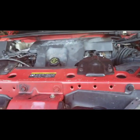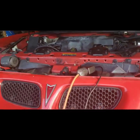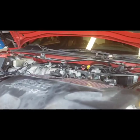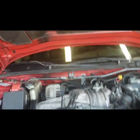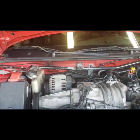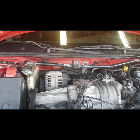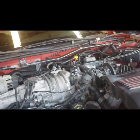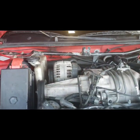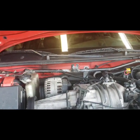My impact's dying, so I'm going to go shopping — grab those bars and also buy the flywheel, because I'll need to take it to the machine shop and they take a couple weeks to get it back. Now, those engine support braces are like $85, and I'm not paying that for a piece of metal with some sliding hooks. So I got a strut bar off a Chevy Cavalier convertible and I'm going to lay that down across, use a couple bolt holes to keep it secure once I pull the struts out, and use a ratchet strap on that hook back there to hold the engine in place.